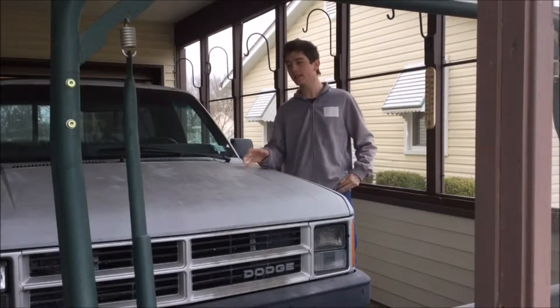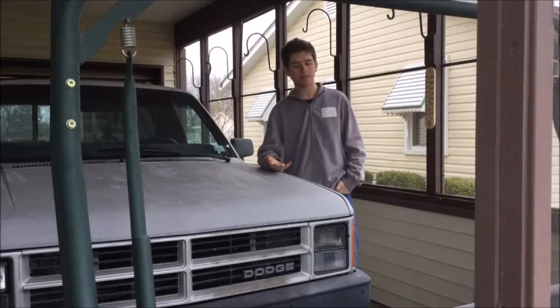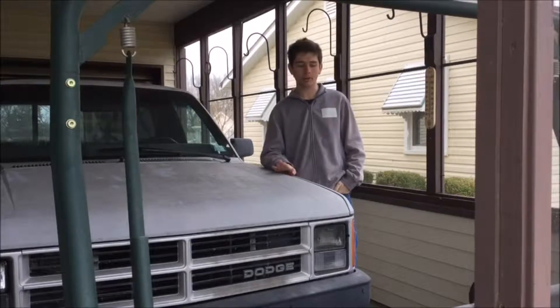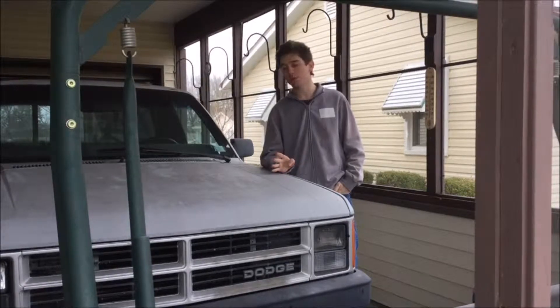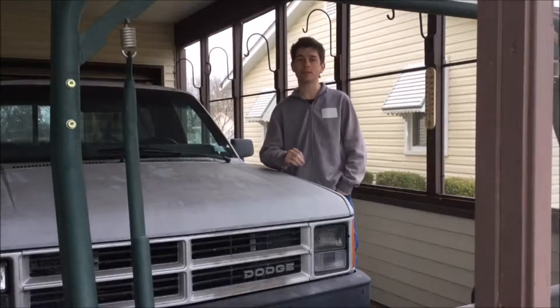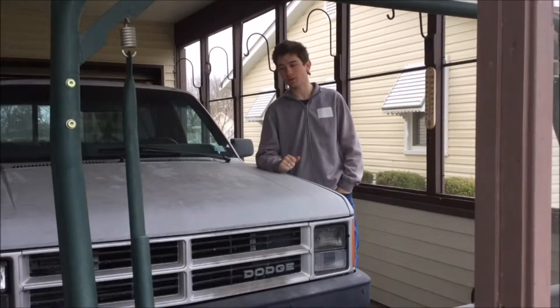This is my grandmother's 1989 Dodge Dakota. Technically it was my grandfather's, but he's no longer with us. This thing is a very reliable truck. It runs great, but we do have one problem with it right now, and that is it overheats. No one knows the last time the antifreeze was changed in it, but we're going to be doing a radiator flush because of its overheating problem, and we're going to put some fresh antifreeze in it — extended-life antifreeze — to help keep it up to par, because this thing doesn't get maintained as well as it should.